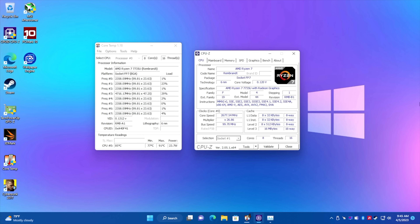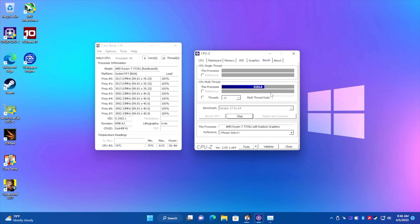We've got everything set up from the BIOS, we're in performance mode, and I was really interested to see what TDP this was running at. Keep in mind this is the 7735U — the non-HS variant — so it will run at a lower wattage. With Core Temp running a quick stress test, we hit 50 watts, dropping down to around 42 after that initial burst. We could use a third-party app to up this TDP, but I'm going to leave it like this because the cooling system is still pretty quiet even at 42 watts and we're not going to hit thermal throttle while gaming.